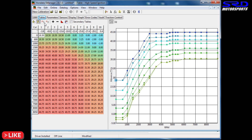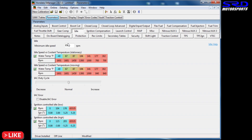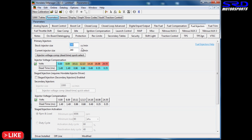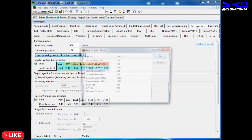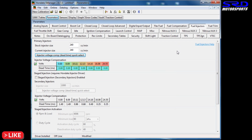You can reference the same areas as in Chrome and HDS — it works the same way. In parameters, you can adjust VTEC engagement and idle. You can check the target idle and ICV control just like the other platforms. Here's the rev limit, and the cool thing with HonData is each gear can have a different rev limit — that's very user-friendly. For injectors, it has preset battery offsets; for example, if you have RDX 410cc injectors you can choose that preset, which makes tuning easier.